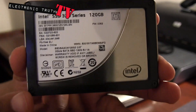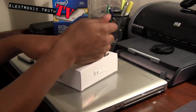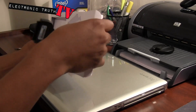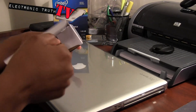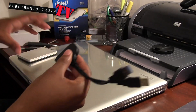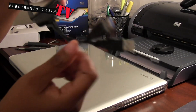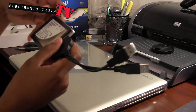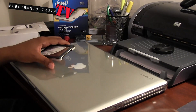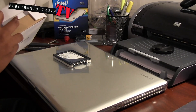It's nice and shiny, 120 gigabyte hard drive, and it comes with a lot of different stuff. There's this little cable if you want to use this externally, which I am not. It's two USB into a SATA connection - it goes like this and plugs into the two USB ports. It is a beast, and this is a SATA or Serial ATA drive.